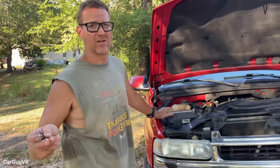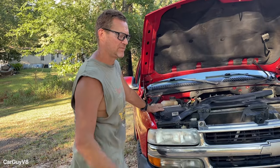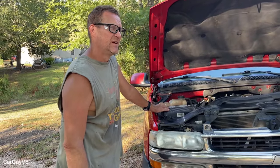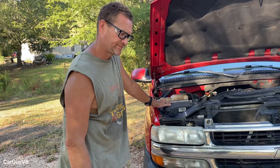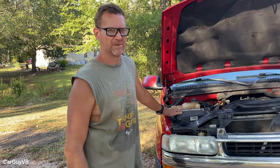That $800 included the fuel line, getting the wiring harness separated out, and getting the PCM tuned for that setup. That also included the suspension — I had to redo parts of the front suspension on that car — plus engine mounts. You've got to take care of engine mounts, a set of headers, and modifying a transmission mount. This is just G-Body, but I think most of your budget builds are going to involve a little bit of fabricating.